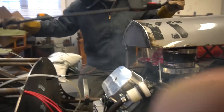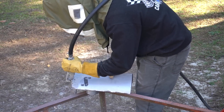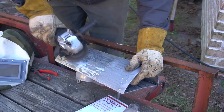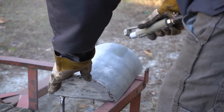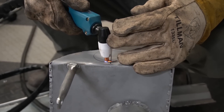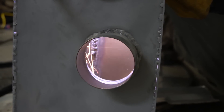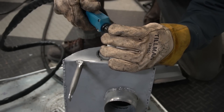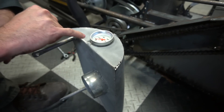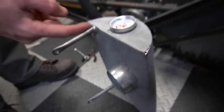For the first time on Cars and Cameras, we are sandblasting! Sandblasting is a great way - probably the ideal way - to remove rust from metal, or in this case paint and stickers. We're going to weld up that hole right there that I put in there, and we'll need to drill a hole in the bottom for the wiring. We are filling in a couple holes that revealed themselves when we sandblasted it, so I'm gonna do some welding.